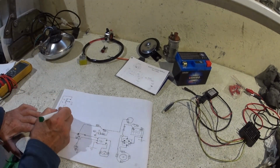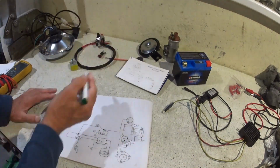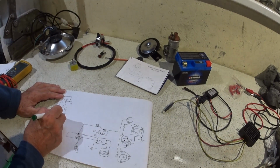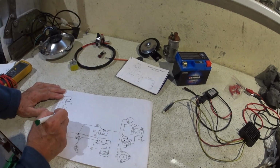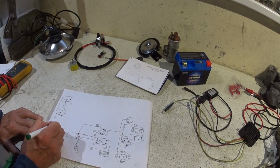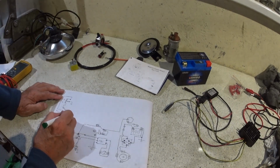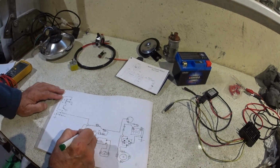we do that side. But what I'm interested in is we've got another 2 buttons, haven't we? We've got the horn, which again is a ground signal going back. So we've got that to ground, and another one beneath it, and that'll be the horn, won't it? And that will give an onward ground signal. So we'll call the top one the kill button and the bottom one the horn push. So the kill button is going to come to there, isn't it? Kill. So let's go there, there, there, there, and there.